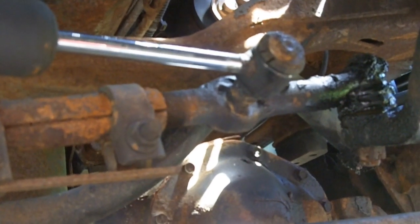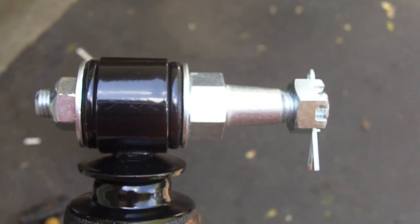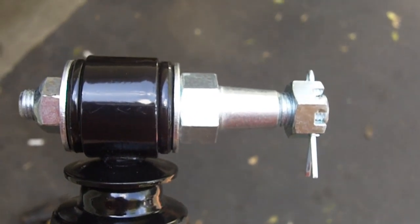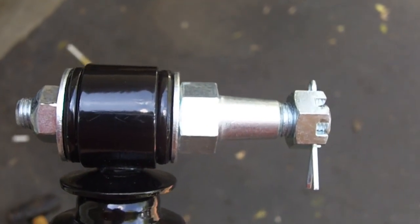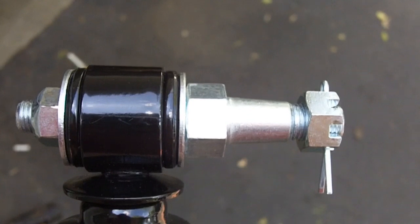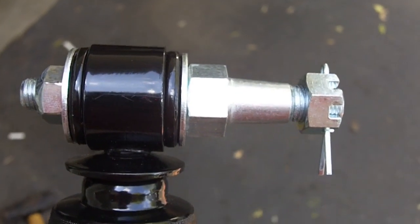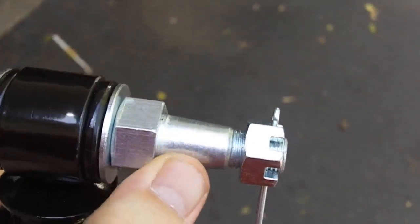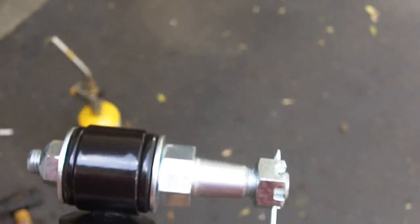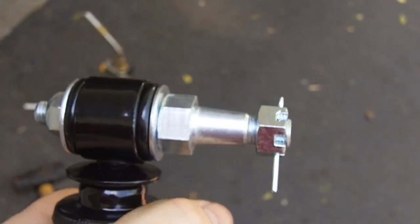So we'll probably start out by heating up this end with some map gas, and we'll hammer it out then. This piece that's still mounted in the truck — I ran into the same problem with the wife's Jeep where it is basically unmovable. I tried heating it, hitting it with a sledgehammer, but there's not a lot of room to work in there, so you can't really get a good swing at it. So what we're going to do is cut it off right about here, leaving just a little nub that's stuck in there, then heat it up and bang on it and hopefully it'll come out.